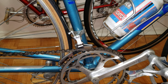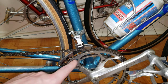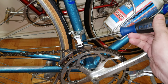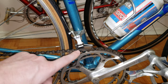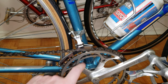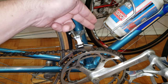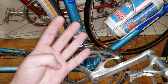The very last reason — and this is what I see on bikes that were left out in a cold and wet climate — is oxidation, rust, and gunk on the screws that make the derailleur move right and left. The derailleur gets sticky. What you have to do is apply some citrus degreaser and then lube it up with some chain lube, and that will free the derailleur so it can go right and left and shift from the small chainring onto the big chainring.